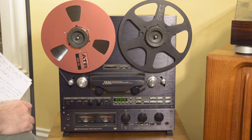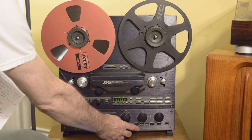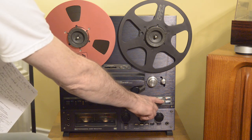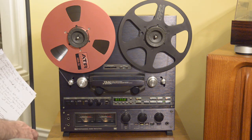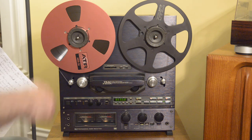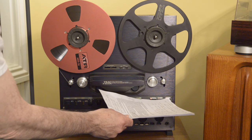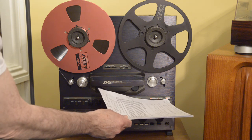Let's go ahead and do a record demo. In order to record there's a safety switch — recording mode — so that you don't accidentally erase your tape. The record button will flash, so make sure that's flashing. We are at zero. Then you hit record and pause at the same time — press record first, then pause, that's generally what I do. Make sure that both buttons are solid. If this is still blinking you didn't really catch the button, and you'll go through all your recording and it won't be on the tape.